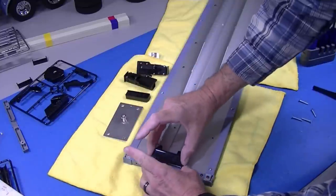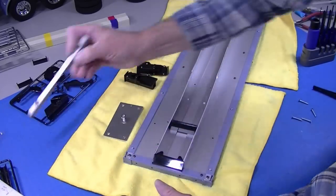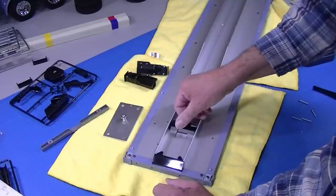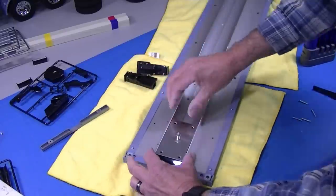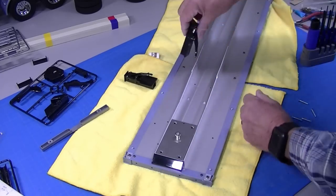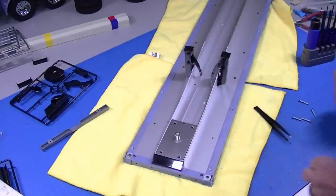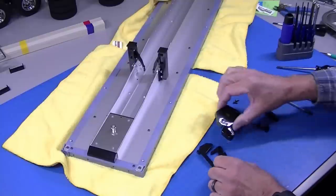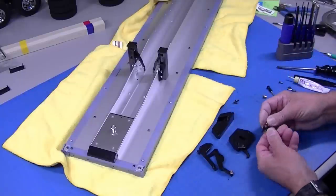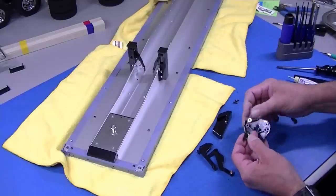The front part of the trailer: this piece drops in here, this one drops in here, and we put bolts through into the plates on the back side. This piece drops on and it's important to notice that the pin is on the further back position. The legs just bolt on to the sides here. The mechanism to operate the legs is pretty straightforward to assemble — they just have a bushing that pulls in and a screw that drops down through the top, and you wind up with this assembly.